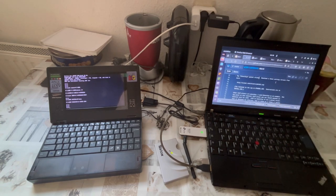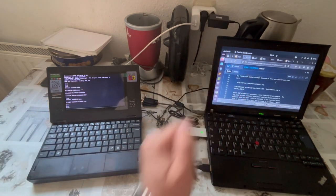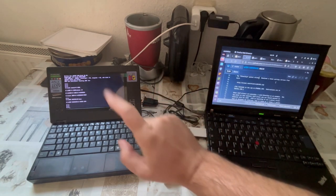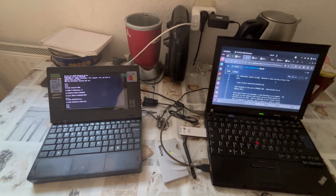The next thing you need to do is to get a packet driver, which is a sort of little DOS program that you'll be running here. Of course, you get it on Linux, but you need to transfer it to DOS and run it there. Its task is to change that serial line, from the perspective of DOS, into an Ethernet line. It is going to be a virtual Ethernet line, similar to what would be happening if you are using dial-up internet. Only we will be going for something called SLIP, Serial Line IP, not for PPP, which you might have also heard, because PPP is just simply more of a hassle to set up, whereas SLIP is extremely straightforward.